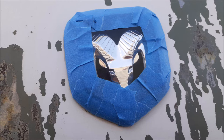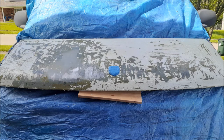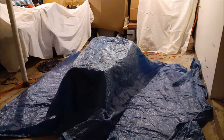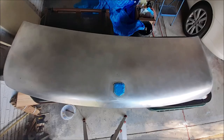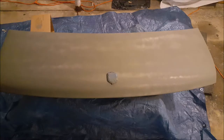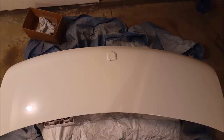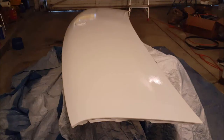Then I turned to the Rust-Oleum Turbo Spray and used self-etching primer along with a lot of paint remover. I decided to leave the trim in place and tape it. I also decided to take the hood off the vehicle rather than paint it on — lucky, because it was windy. This is my cheap little attempt at a paint booth — a super real DIY. I sanded it down to bare metal, put about three coats of primer on, took it outside and wet-sanded it lightly, and also wet-sanded the finish coat. My basic painting philosophy is that prep work is the key to everything.